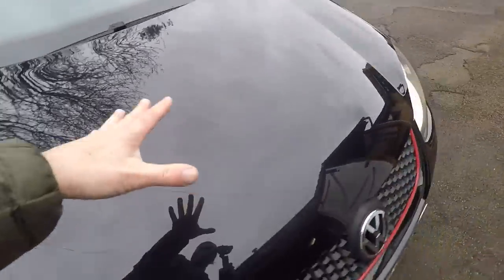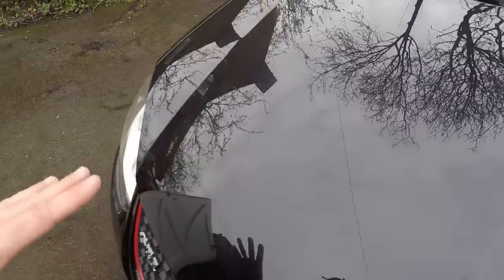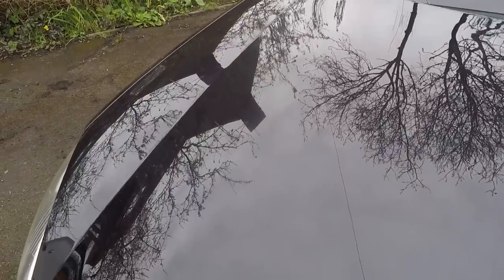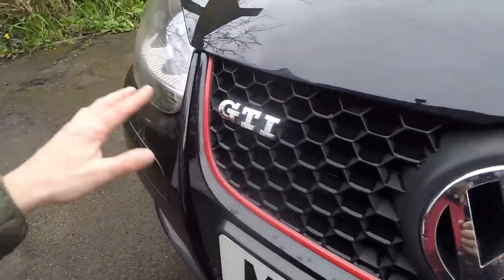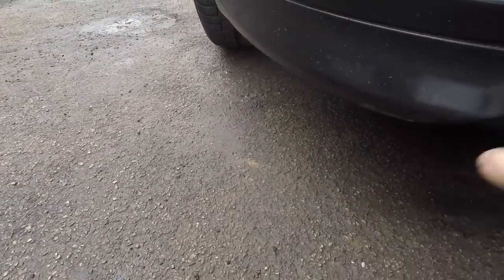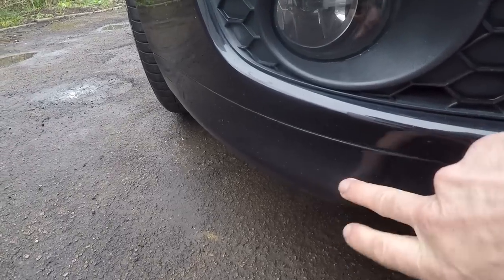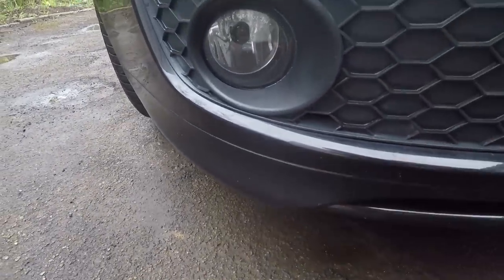Let's have a look at the front then. The bonnet is obviously really exposed — Mark Vs chip really badly here. We've got loads of little chips, but actually for 70,000 miles, I can tell you right now this is not original paint, just purely by the lack of chips. Also, if I look carefully at the lacquer, there's some inconsistencies here and there — it's not bad, but it's just a little hint that this isn't original, so it's no real surprise. The headlights, which have been polished, they're not chippy, so that's good, and the front bumper actually is really good — I wouldn't paint it, and that's a sort of testament to its low mileage. Down here though, the body-coloured front valance on these Edition 30s is chippy. Also, it's got a scuff here, and I've painted these many times — they do get battered. They chip a lot worse than the bumper just above there — it's almost like the paint isn't as good, so I think we'll paint that.